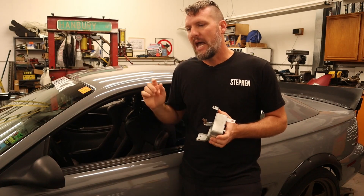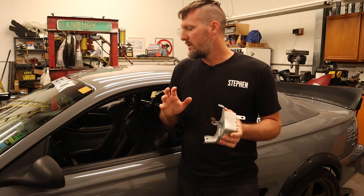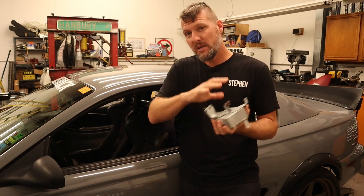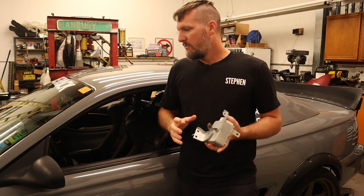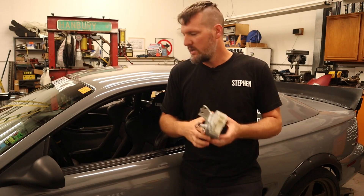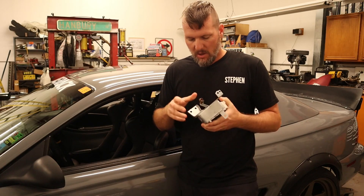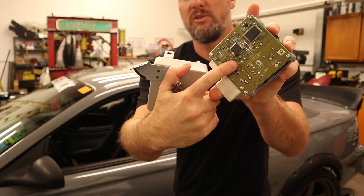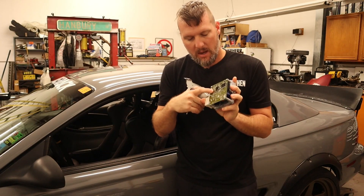With the Prius steering column I put in an aftermarket controller from Inductive Auto Works. I've been talking with the manufacturer about some inconsistencies in what the Toyota controller was sending to the power steering controller, which led me to go pick up another ECU — really easy to grab from another Prius. I swapped that in and then also took it off to look at it. The one that came out has a burnt section on the control board.